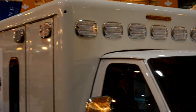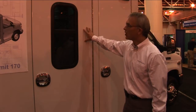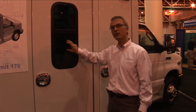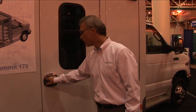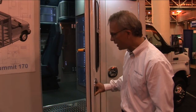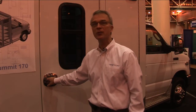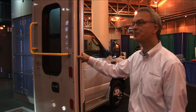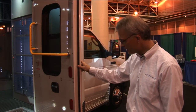On both the outside and inside of the vehicle, we use LED lighting to reduce electrical consumption. We also insulate the entire vehicle — the ceiling, the floor — and the windows are thermal pane glass, so we're able to maintain a very good environment on the inside. The handles use what we call a free-floating latch: when the doors are locked, the handle floats freely so you're not constantly wrenching on the linkages and pulling them out of alignment. The doors are fully welded 0.125-inch aluminum box pan-form construction, making for a very solid, durable door, and we put the seal on the outside of the latch to protect it from corrosion.